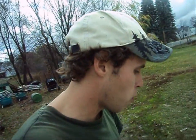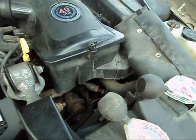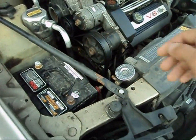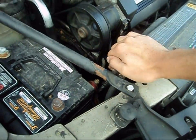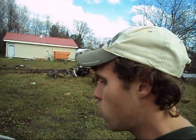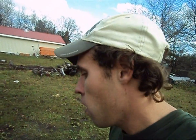I check my engine coolant in the fall for freeze temperatures and in the springtime for my boil-over temperature. Go ahead and pop the hood. First things first — before I touch the rad cap, I just feel it to make sure it's cool enough to open. Another thing I usually do is pinch the rad hose. If the rad hose is soft and you can easily squeeze it, you know there's no pressure. If it feels firm, you know you still have pressure built up in the system and you shouldn't open it just yet.